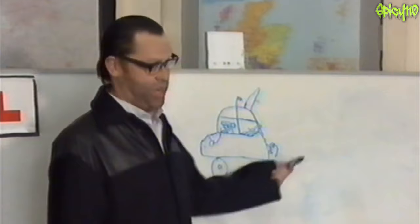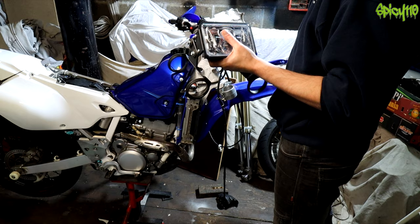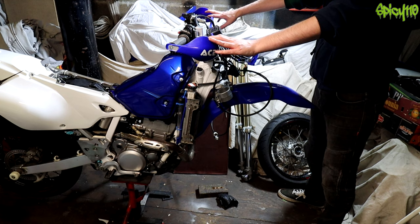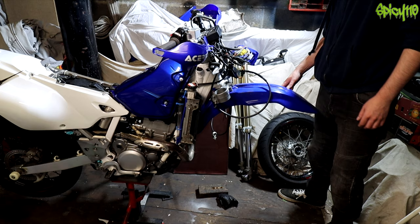Let's take the headlight unit out. Okay, the headlight assembly's out - these are the bits that the forks go through, and these are the bits that make it difficult to feel the forks going through the yokes. Now that's out of the way, the forks are out and we will truly know if it's the headstock bearings. Look, you can actually see it now.